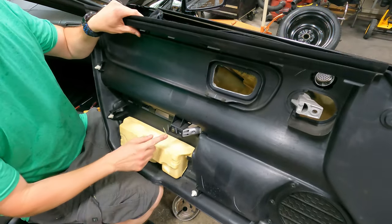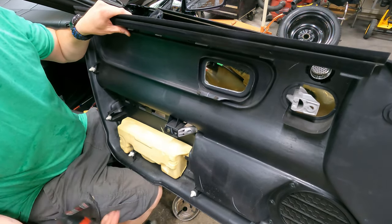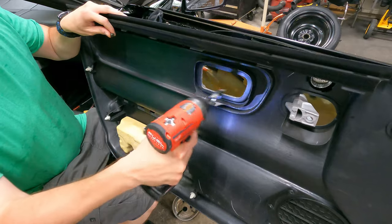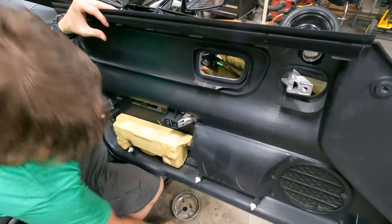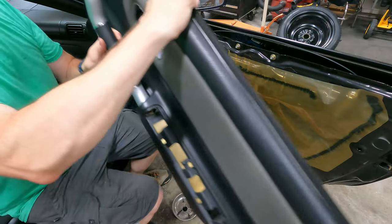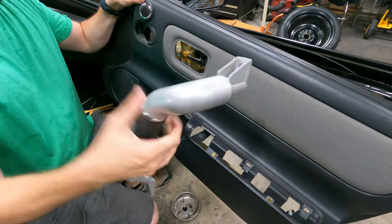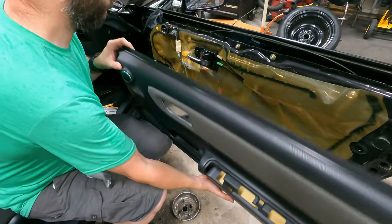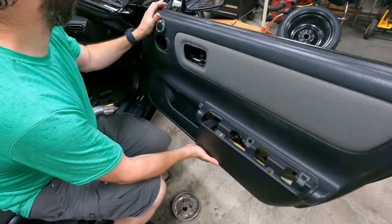The whole point in removing the door panel is to get to this one screw. When I did the other side, I was able to pop the bottom off and then use a ratchet Phillips head to get that out so that I didn't actually have to take the part off around the door handle where it opens. Once that screw's out, turn the door panel back around. This whole assembly slides forward and lifts out, and now this whole piece isn't needed anymore. I'm just going to quickly inspect the inside of the door — everything looks great, so I'm going to go ahead and put the door panel back on.